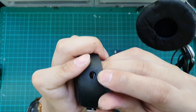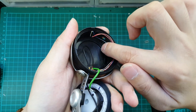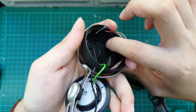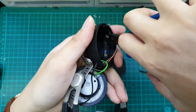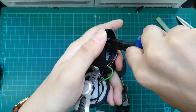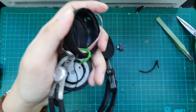We have the entry hole here and what appears to be the part holding the gasket down. There are some plastic mounts on the bottom side — we will remove them with a pair of wire cutters. We have to remove them because the female socket needs more space in order to sit flush.